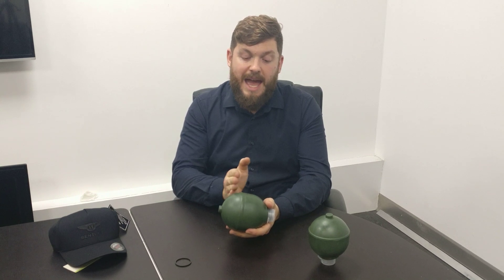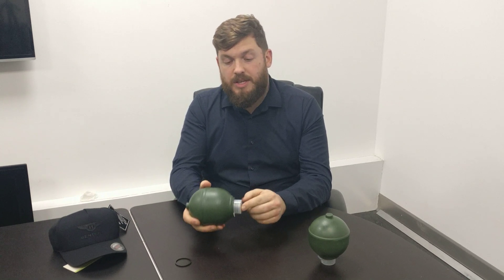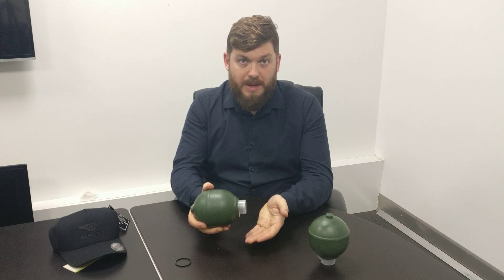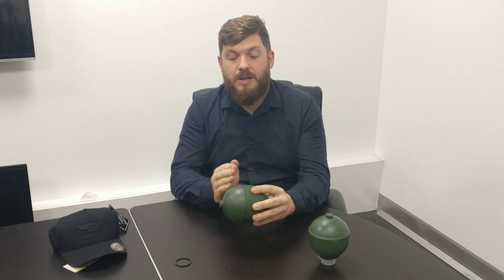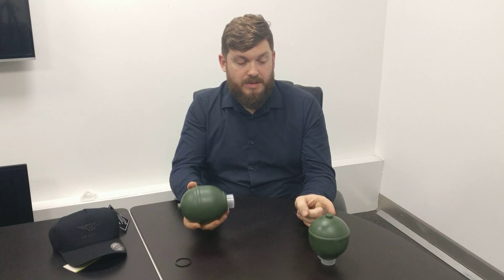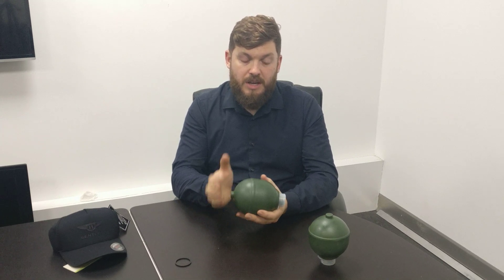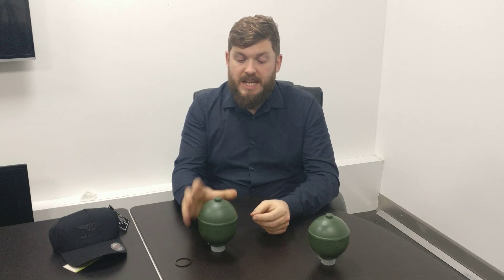What this allows you to do is that pressure is actually acting on the diaphragm, so this is an actual spring. This screws into the valve body on top of the damper, and when the suspension goes up and you push the telescopic damper up, it pushes the fluid into this and against the pressure behind the diaphragm. So that's a completely different pressure to the CD6000 — this is much higher pressure. And I think if you put one of these in place of the other, your suspension is just going to go solid because it won't be able to move.